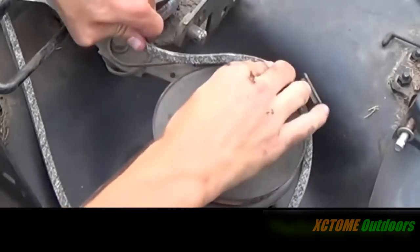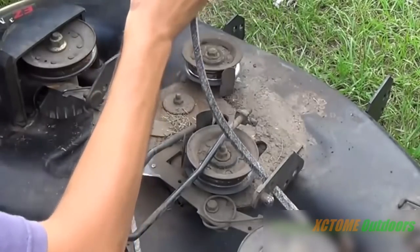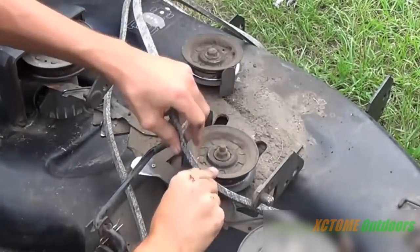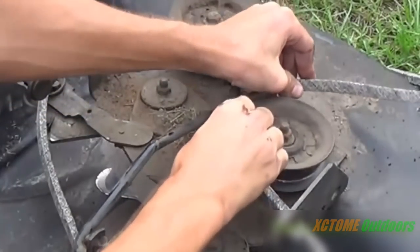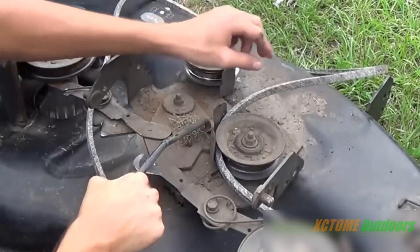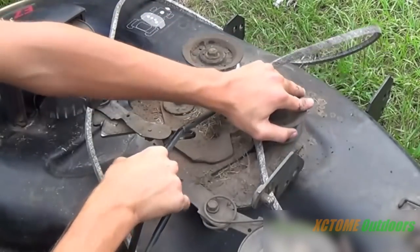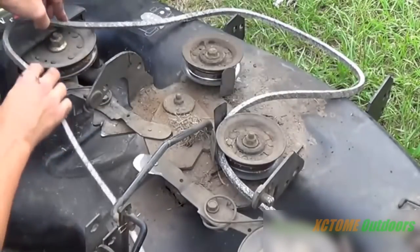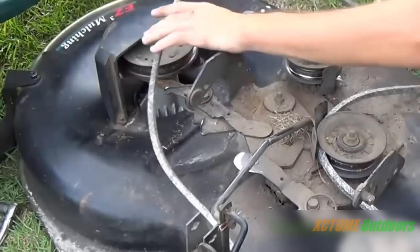We're going to route the belt, putting the V-groove in. It wanted to twist on me — you're not going to let it twist. Now that it's untwisted, we're going to route it through here. This little belt guide clip right here — pull it — that's disengaged, and that's where it should be. I can see why it's throwing the belt off now: there's a little stopper made onto this bottom plate that is gone, because this arm is not supposed to go out this far. But this is an old mower — you've got to keep that in line.